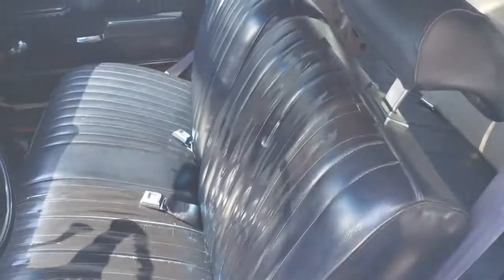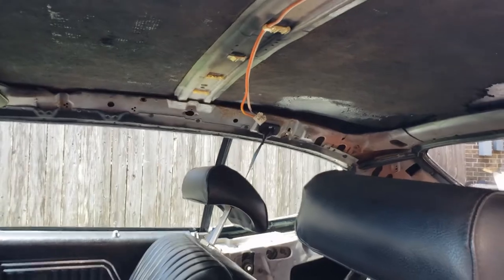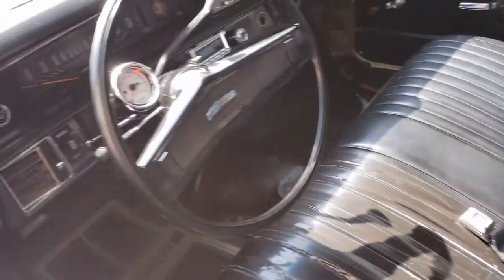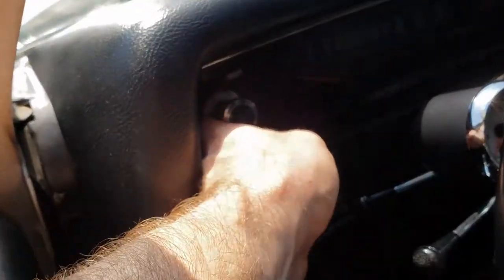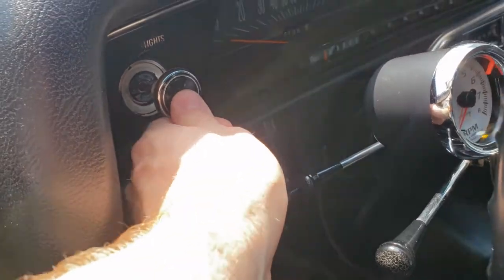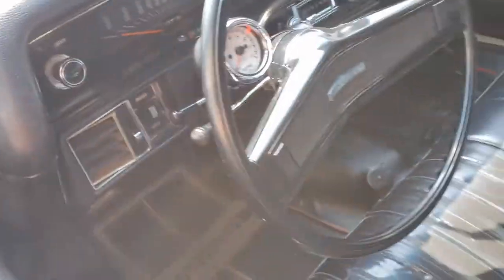For the interior, I haven't done much, although I did figure out the dome light — it wasn't turning off no matter what you did. After a lot of wiring tracing, I found it was a bad headlight switch, because the dome light would turn off when you turned the headlights on. Just bad contacts in the switch; I'll replace it — not worth trying to fix.